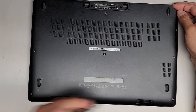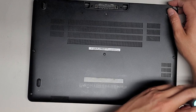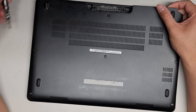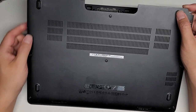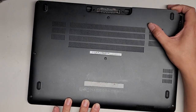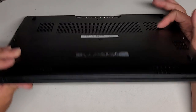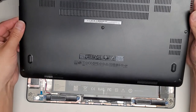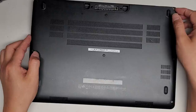Most likely the back here should pop up and the bottom should swing out here. So you want to lift this up like this — it's kind of stuck. Work your way over and lift it up. So the clips here at the bottom are in like this — I snapped them back in place. They actually swing into place, you don't click them in. So when you take the cover out, you put them at that angle and then put it down and put the screws in.